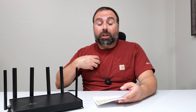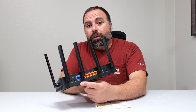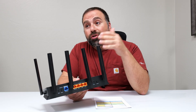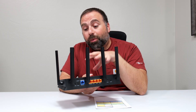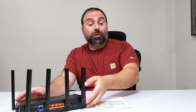Let's jump into the internet speed test. When you're accessing the internet, you're limited by your internet speeds. For me that's 5 gigs up and down, and this router can support up to those speeds because it has a 10 gig port. However, the ports coming out of it are capped at 2.5 gigabit speeds, so when I do an Ethernet speed test on my computer I actually get just under 2.5 gigabit. But at the router itself, it can still sustain up to 5 gig speeds — so in theory, if a Wi-Fi device were fast enough to reach 5 gigs, it should technically be able to do it.